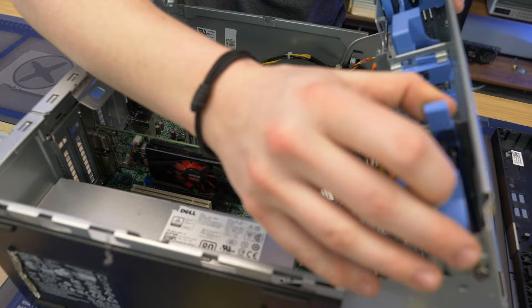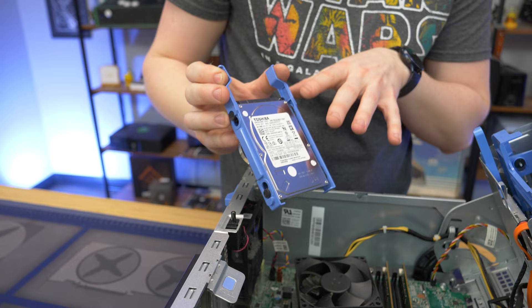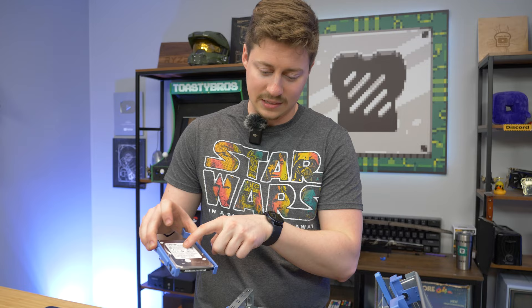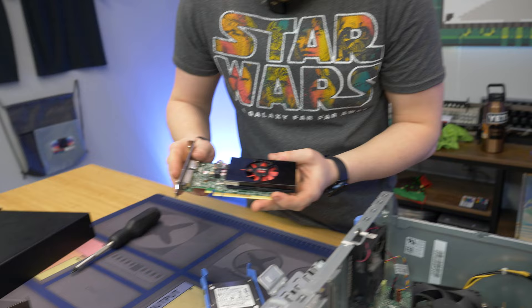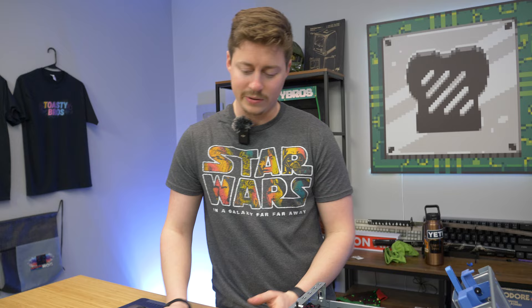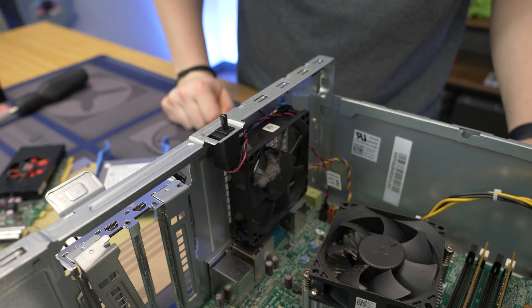So it looks like we got a 500 gig laptop drive — that's an interesting choice, might get a little slower. They must have just had it lying around. But we are going to be adding a 240 gig SSD. We also didn't budget for it to have a graphics card, which it does, so we're going to pretend the 240 gig kind of balances out. We have an AMD Radeon card that is probably like an R5 240 or an HD 8450 — just a 1 or 2 gig card, nothing great, just for display. Our 16 gigs dual-channel SK Hynix, two 8-gig sticks — that's pretty awesome. We're probably going to give this thing a little bit of a dusting and replace the thermal paste because these things are never replaced.